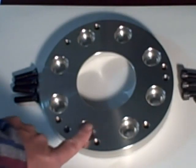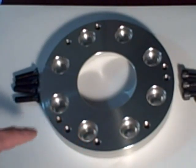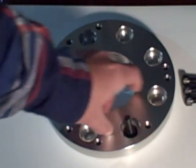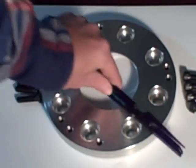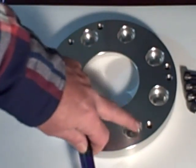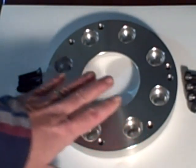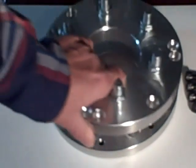You're also going to have to cut the studs of your vehicle. Your truck is going to have a stud sticking up through here past the surface of this. You have to grind and cut that down so that this is completely flat. The stud coming out of your vehicle cannot come past this surface right here, so that the second piece will go flat down on there.